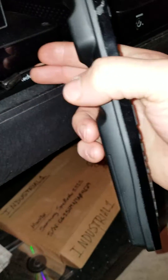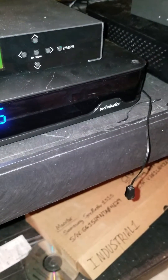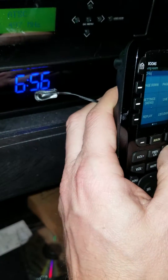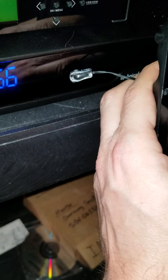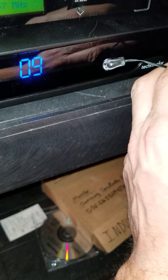So get to the cable box — the device you're trying to find — and then take the emitter, and as you press a channel number, you can begin to run it across the face of the unit, pressing the channel up or down button at any moment. Once it starts to respond, which it does there, then you can fasten it in place.